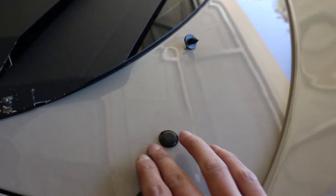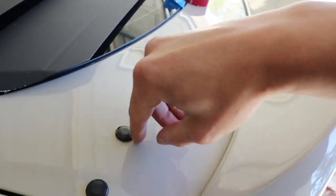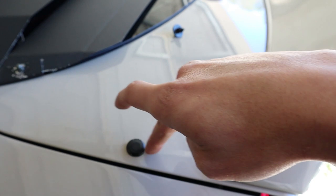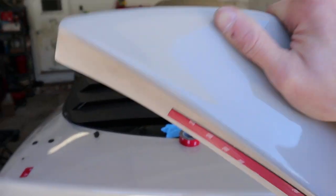Okay, so I cleaned up this area here — got it all nice and as best as I could. I plugged this hole with one of these — I actually put a little gasket on it and stuck it in there so water's not getting in. These don't matter because this just runs down on the side of your trunk. This one's the main one, and I 3M taped it. This hole here I'm not sure what I'm going to do with — I'll probably just leave it open for now. It'll run down along the side and out to the floor, so it's not going to be a big deal. Got my 3M tape on here. All I got to do now is peel it off and stick it on and I'll be done.